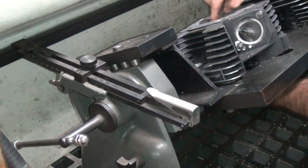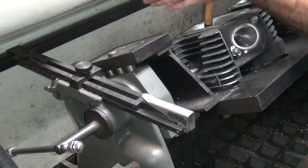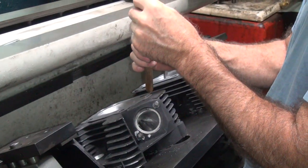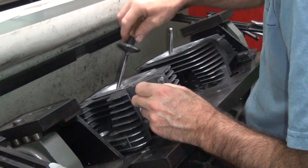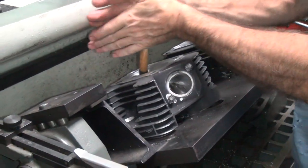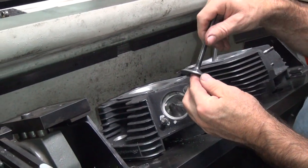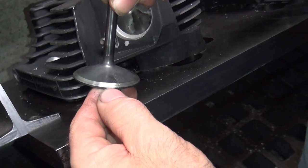Twist the valve — there's something wrong with that guide. These are supposed to be fitted already. Can't even do the valve. Fitting the top? I can't even leave enough of a mark to tell. Something wrong with that guide hole. It's got a mark, but I can't see exactly where it is. But it looks like we're too small — very small. It's on the edge. Yeah, we're only hitting right here on the inside edge.